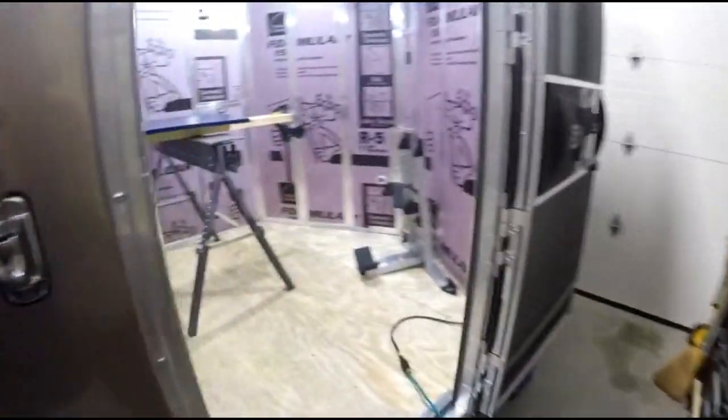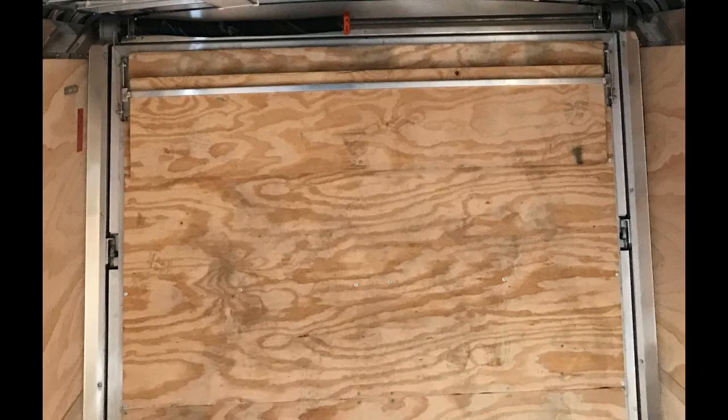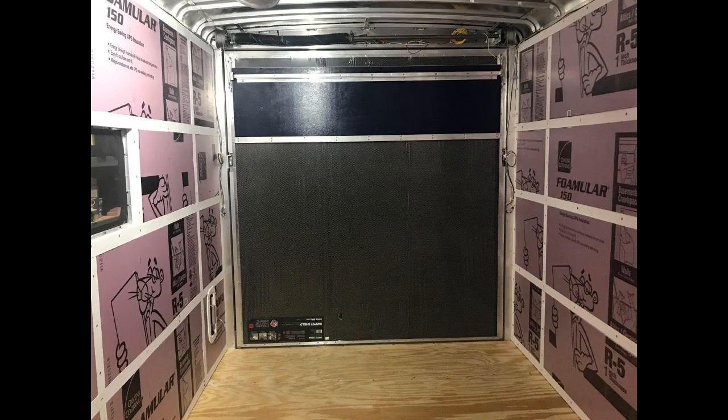Welcome back. Just wanted to give you an update on the trailer project. I went ahead and took care of the rear ramp door — insulated it and replaced the surfaces on the inside. That's the original wood, and that's the finished product. The outside G-channel strip on the bottom was removed; I could see light through it during the water check and had water coming in, so I upgraded that to an aluminum flat stock with screws.